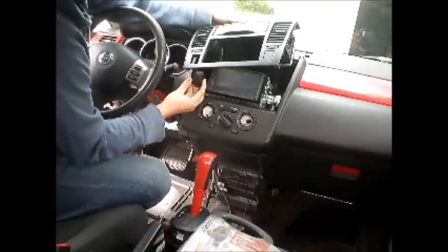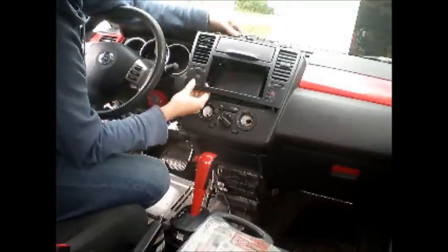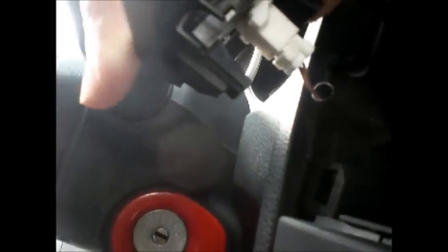This one though is the airbag sensor, or airbag something, and it's going to be popped in like this. I'll give you a close-up of what I'm going to do for that. So for this we don't want to unplug it, because that would make the airbag light go off next time we start the car. So what we're going to do is we're actually going to push on that right there. You can see that. Push right here. And then push on the sensor a little bit. And we're just going to pop it right out. Like that. So now we've popped that right out, and now we don't have to worry about the airbag light at all. And we don't have to unplug the battery when we're doing it. And that can just hang there.